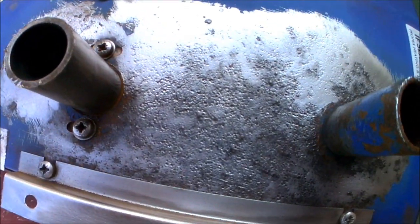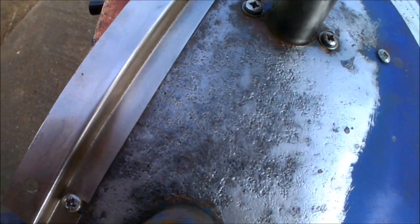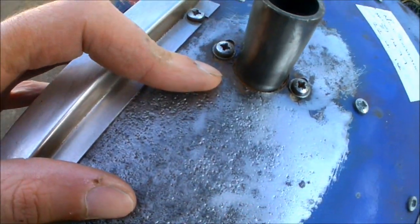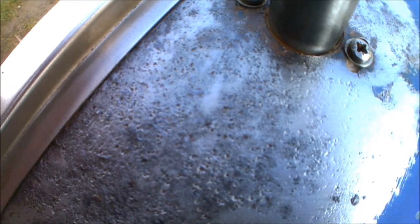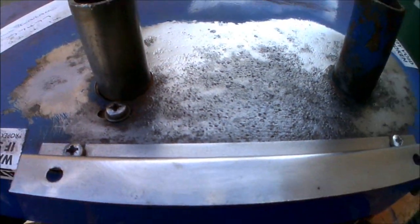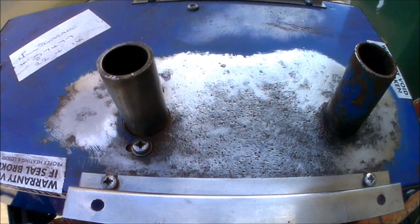I'll speed the reaction up on film, but it'll still take a while. It'll be handy to film it from start to finish just to see the metal turning from silver to a purpley-brown, and that'll show it's actually taking the reaction to any remaining rust. It inhibits any further rust growth and will then be paintable and protected for the future. I'm going to start painting this now and try to get it in a better position where you can actually see the colour change.